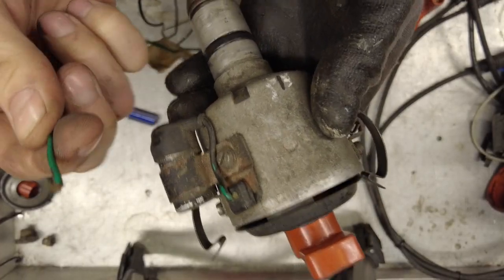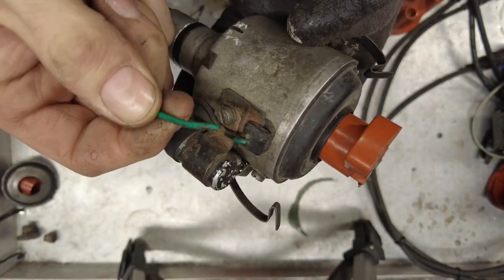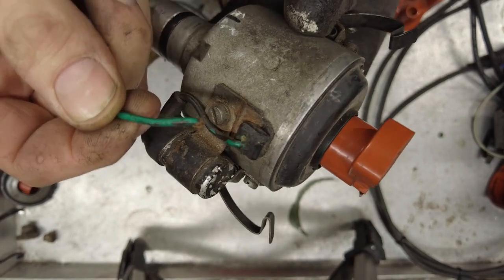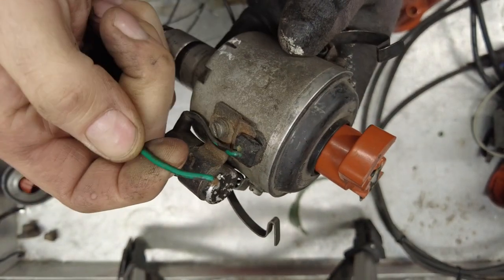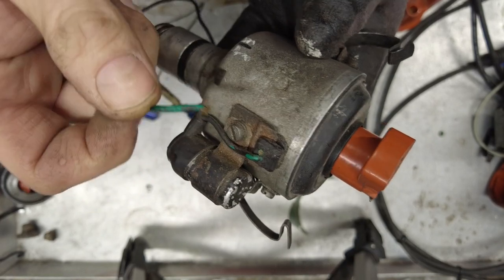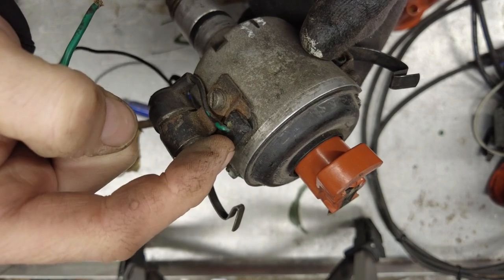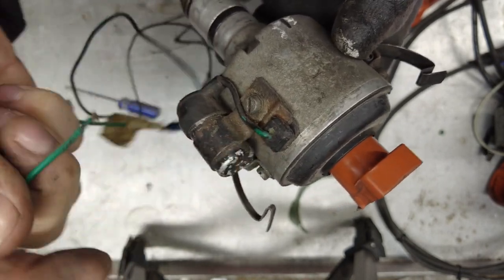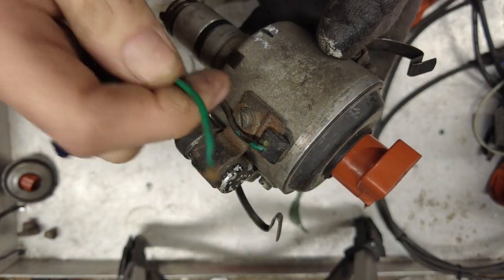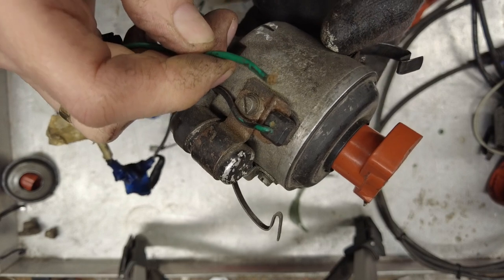Another obvious one, but just for the sake of a second, check your wiring. Your condenser wiring — this was actually attached loosely when we started this video and it actually fell off during the process. These come fatigued and fray, and with age they go hard and brittle and can break off easily. Also when you're fitting the block into the housing, these can damage quite easily if you're a bit clumsy or fit it the wrong way around. Just be careful with that, because the last thing you want is these wires shorting out on the body of the distributor — it's going to cause you no end of trouble.